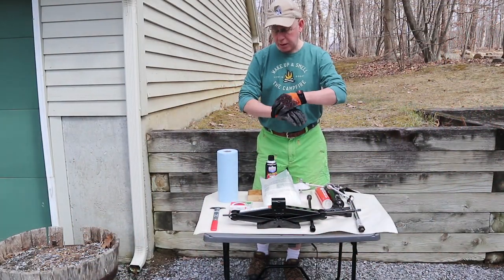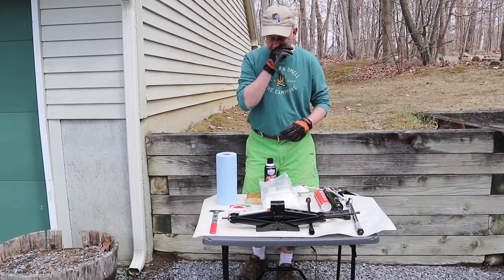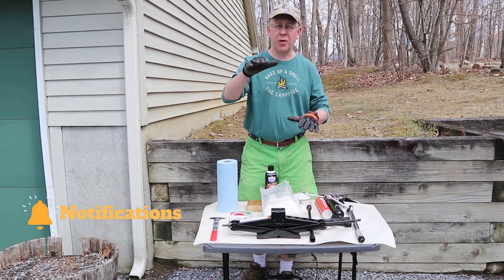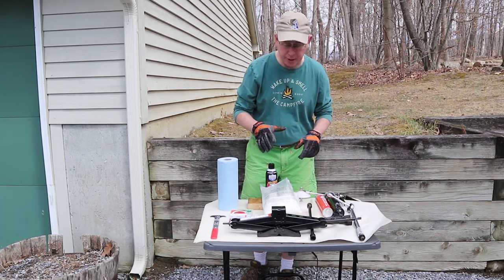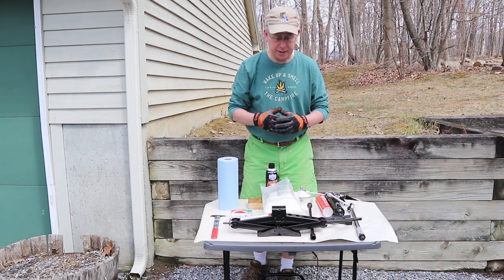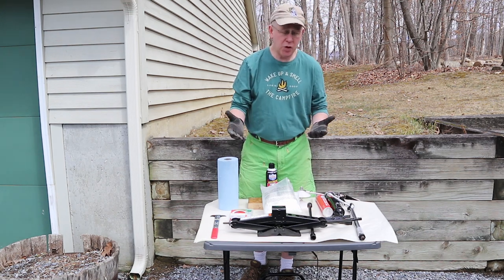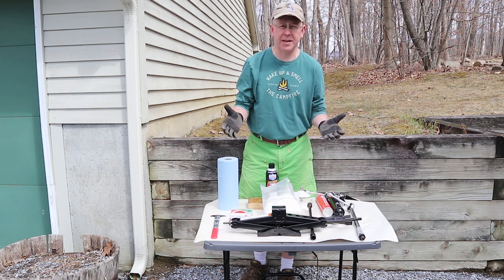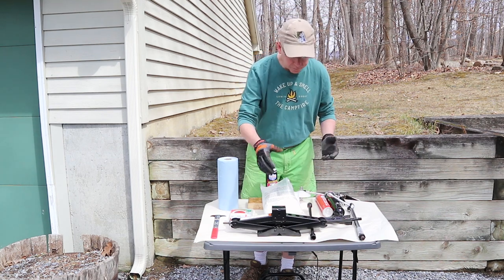All right, let's start by talking about the things you're going to need to get this job done, in the order that you're going to need them. The first is you're going to have to jack up your trailer. With a dual axle, you can use ramps, but that's always so difficult. So I always use a jack at the point specified in my manual on the main frame rail. I use my Ford F-150's jack for the spare tire changing, simply because it's always with me. It's not like I need a separate bottle jack. And the truck actually weighs more than the Airstream, so I'm pretty confident. And you're used to using it. I've done it a zillion times. Between repacking wheel bearings and putting on new tires in 2019, I definitely use that all the time.